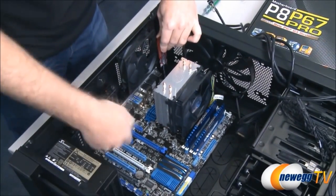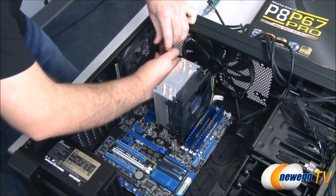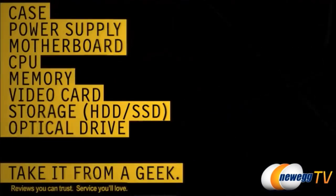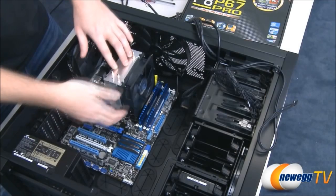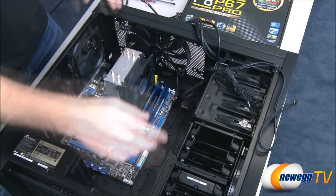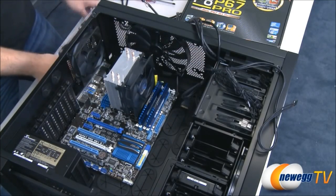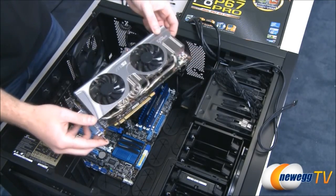So you can actually route that cable behind the motherboard in some situations, but just a little bit of extra forethought to consider there. Now, believe it or not, guys, at this point, we actually have 7 of 8 of those vital PC components installed. The CPU, memory, and motherboard, 1, 2, 3, power supply, 4, the case, 5, our storage drive, 6, and our optical drive, 7. The only thing that's left is our video card right here, and we're actually going to wait